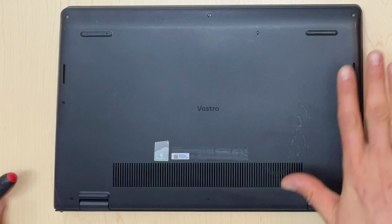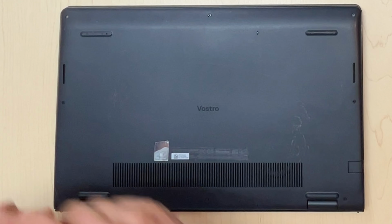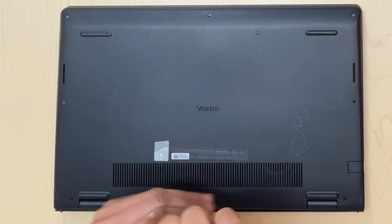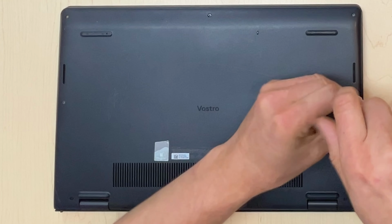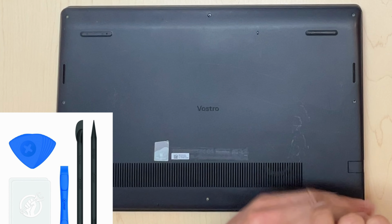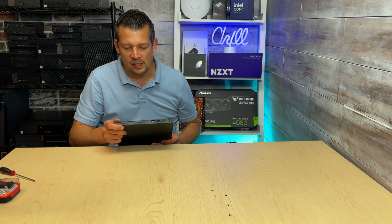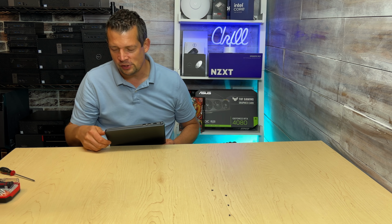Depends on what kind of laptop you are working with. This process to remove the back cover could be extremely easy or could be quite difficult. Even as a service tech, sometimes you're struggling, because it depends on what kind of laptop you're actually working on. Maybe the gap is super small to start prying this apart. Sometimes you use an opener, it's almost like a guitar pick, or even thicker than that, to try to find an opening. Usually around the latches is a good chance we have something. If there is anything on the side, I wouldn't start prying around the ports, just to make sure you're not gonna break these ports off by accident.